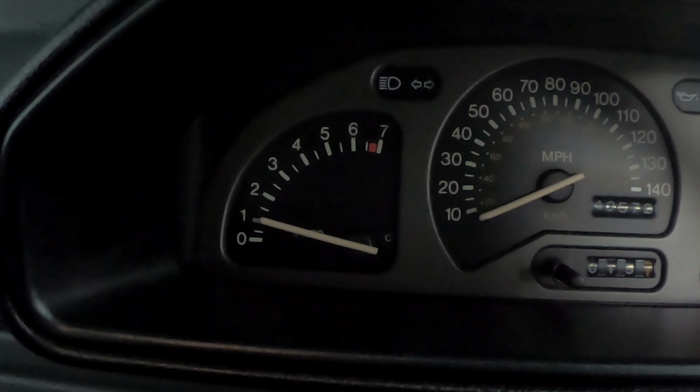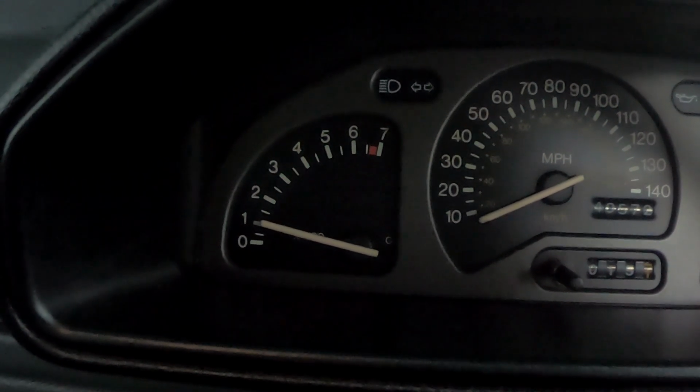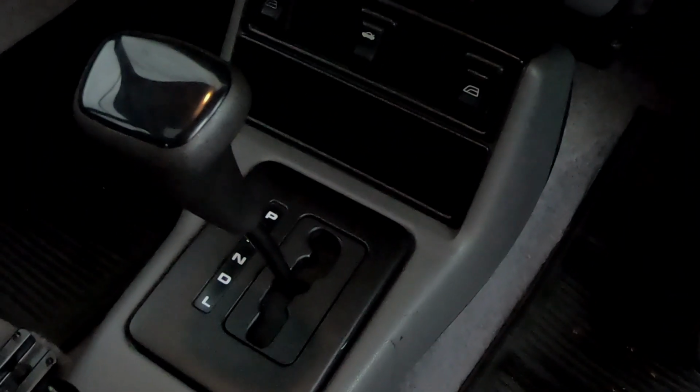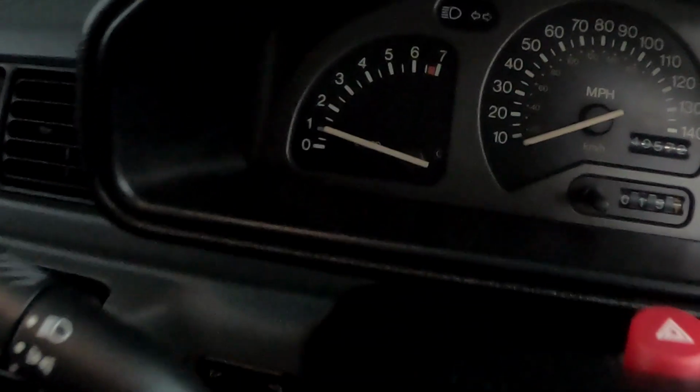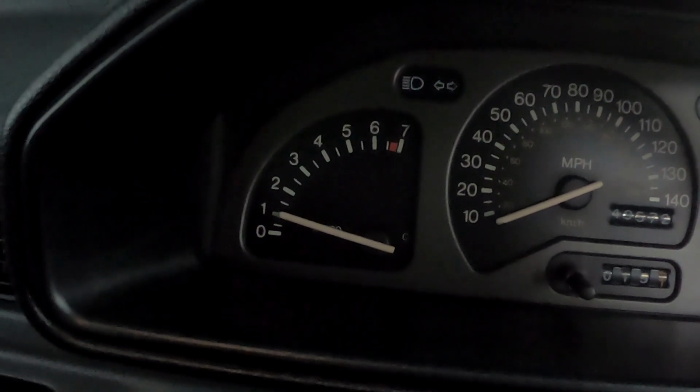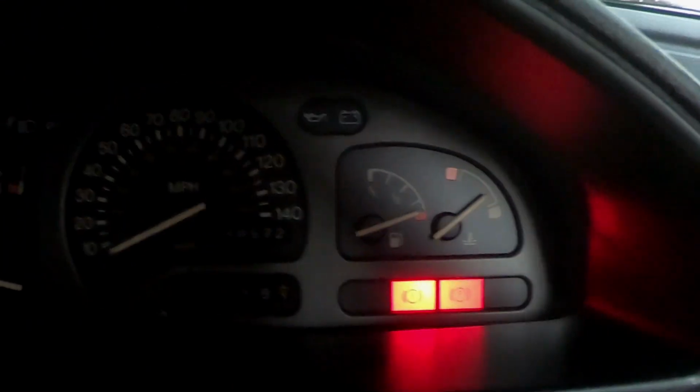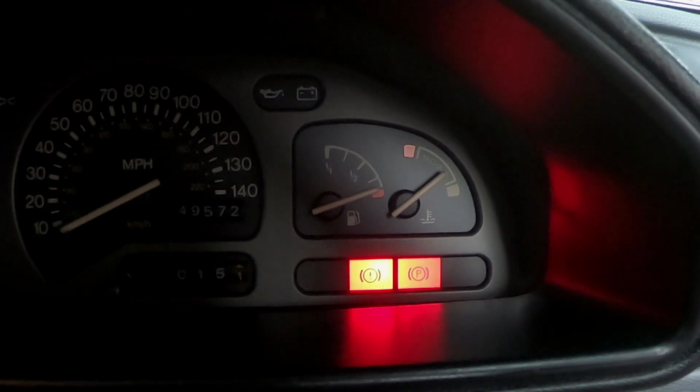So the idle speed has to be a little bit hot. Basically, the idle speed is 300 RPM higher out of gear than in gear. That's rather interesting, but that's steady. We're getting to temperature, and I'll come back when we've got to the middle.